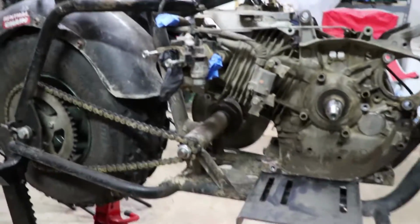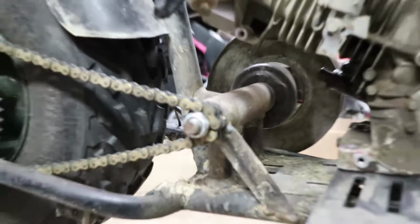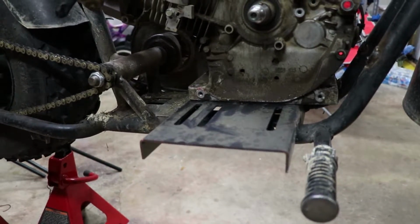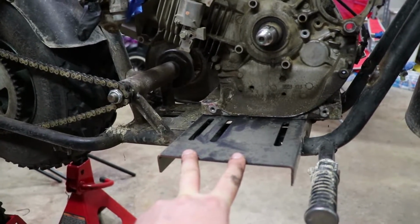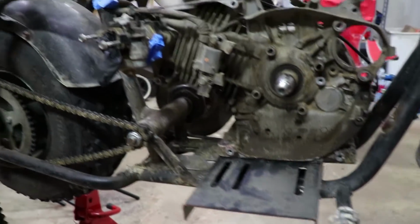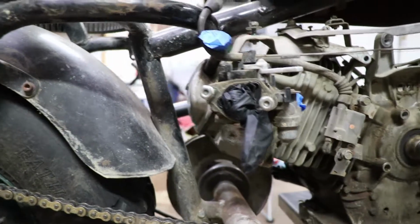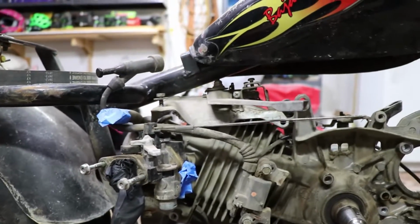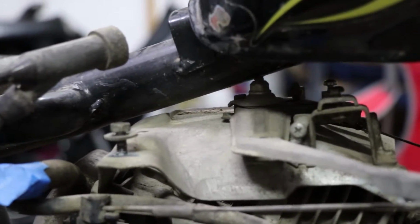Okay, so it's looking promising that I'll be able to keep the existing jack shaft setup that I've got here on the mini bike. This motor mount, I'll have a link in the description for that. So if you're interested in doing this engine swap, you're going to need another motor mount plate or make your own plate, and you're going to have to actually raise it. Because what raising it did is it allowed the engine to slide forward much more, okay? And it allowed the valve cover right here to clear this little beam here. And if you notice, it's very, very tight. That is actually touching the frame, so I might have to notch out that area.